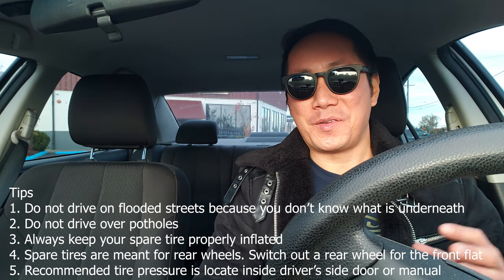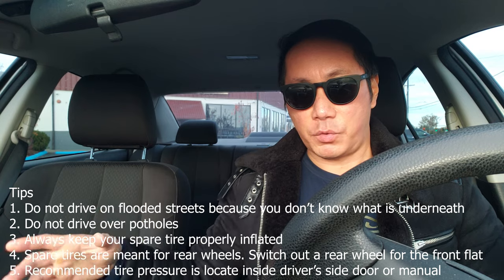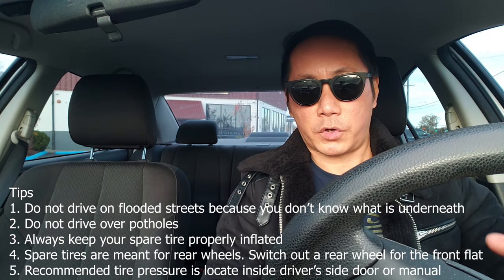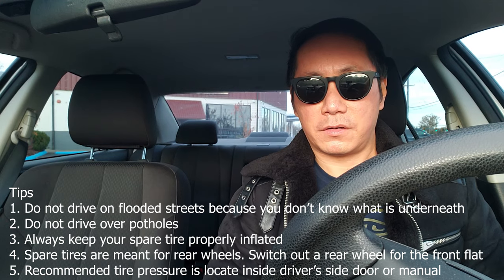In the rare event that your front tire goes flat, what you want to do is jack up the rear and remove one of the rear tires — preferably the opposite side — because you want the car to be well balanced so it doesn't tip over. Put that full-size rear tire to replace the flat front, whether it's the driver side or passenger side. Then take the donut, make sure it's properly inflated, and put it on the rear wheel — it's a lot safer back there. They actually had to hammer the spare donut because it was bent out of shape — I think I damaged it while driving with it in the front going downhill or hitting another pothole. Because it was bent they couldn't fill it with air until they hammered it, otherwise it could blow out. But now it's at the proper PSI. Most spare tires require 60 PSI because of the smaller surface area — you need more pressure in that smaller tire.